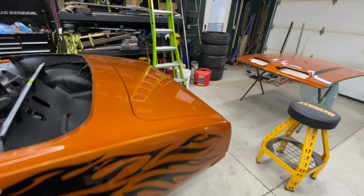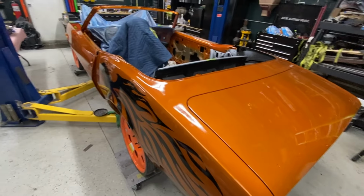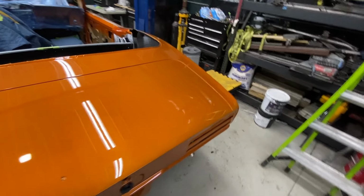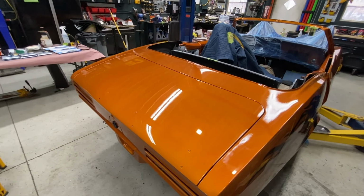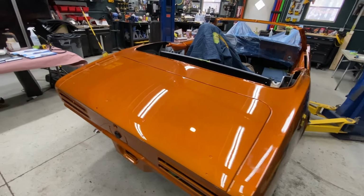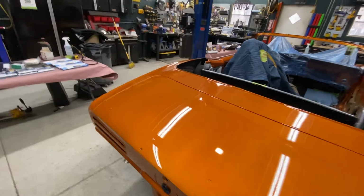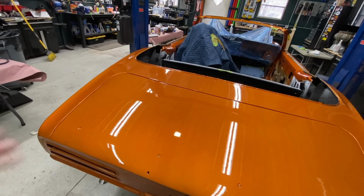There's guys out there that really know what they're doing, like Faraway and Sprayway Customs and Carthage Custom Cars or Classic Cars. Those guys do really nice work, and I've been watching a lot of their instructional videos, and it really sheds light on what you should do. It's not terribly difficult. I've got so much clear coat on this car. Before I did the initial cut down and flow coat, I had many coats over the graphics, but there's a good solid 3 coats of clear everywhere. Then I did the cut down and then did 2 coats on a flow coat.